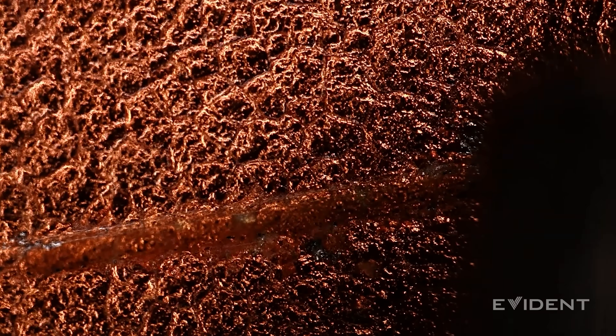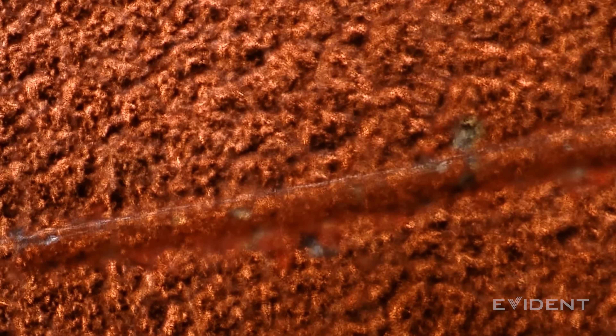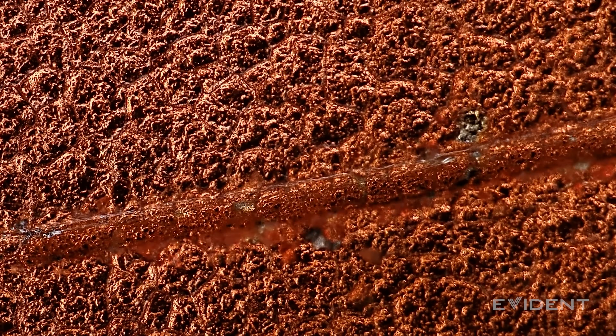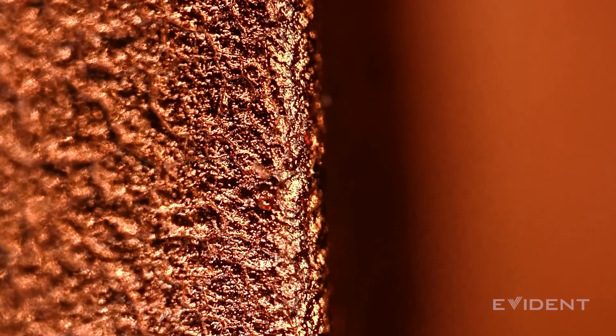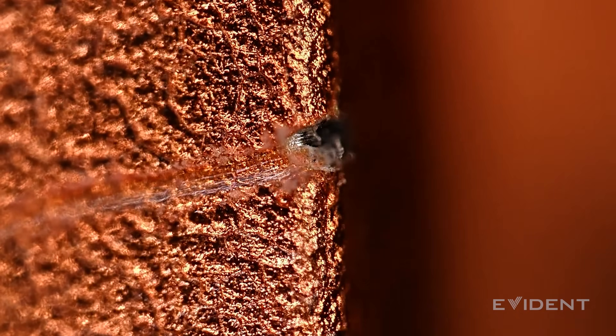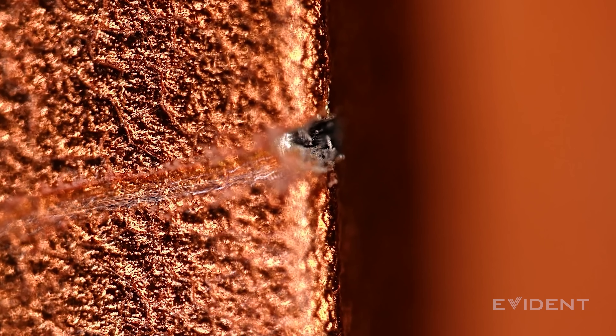We're really able to see what's going on under Evident Scientific's DSX-2000 microscope. Using a Mohs Level 4 hardness tester — roughly the equivalent of a copper penny — notice the scratch on the flat orange surface, where the anodization has properly formed in an even, thick layer. We still get a visible scratch, which isn't great considering the hardness of keys and pennies in a pocket, but it's not terrible — the scratch doesn't peel away the orange color. Now contrast that with the scratch on the plateau, where the anodization is mostly supported by another layer of anodization instead of the underlying aluminium. And that's pretty terrible.